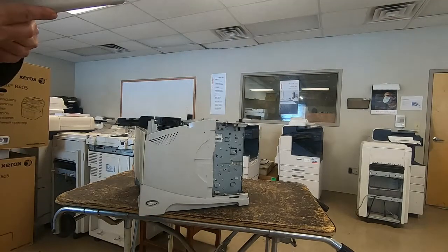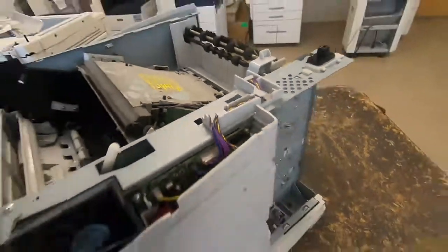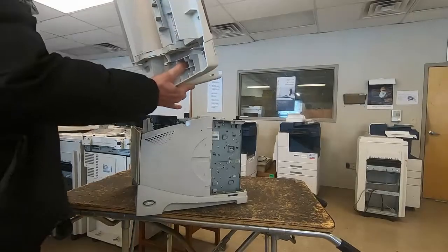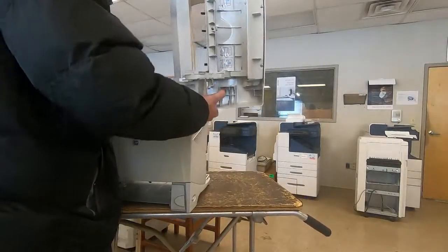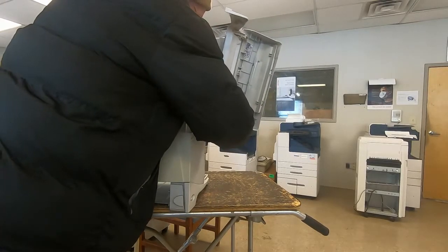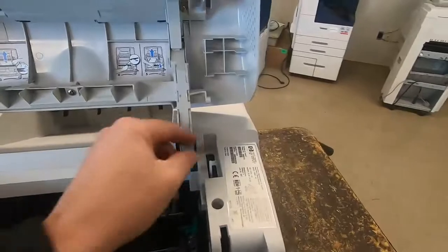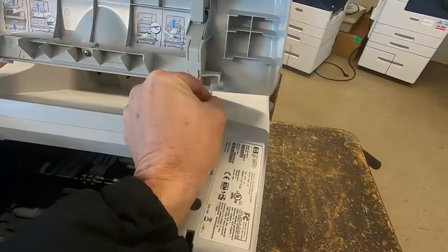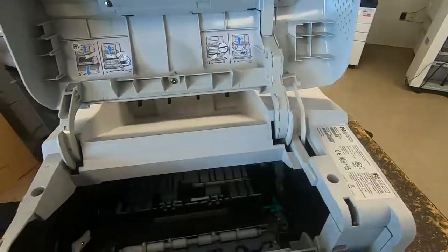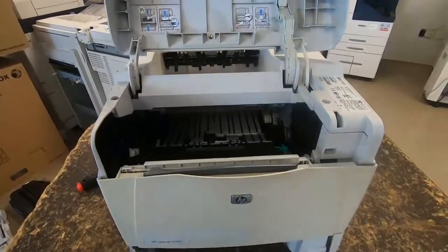Top cover is a little tricky. You need to get the plug into that socket right there. What you want to do is kind of hold the top cover at an angle with your one hand. Also, after you put the top cover on, you want to reattach the toner disengaging lever. Make sure it moves freely. And then you are all set with your brand new swing plate.